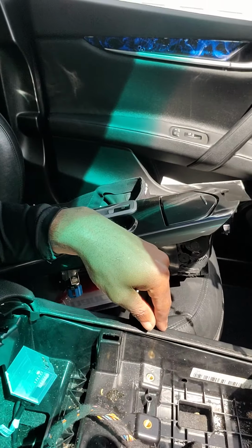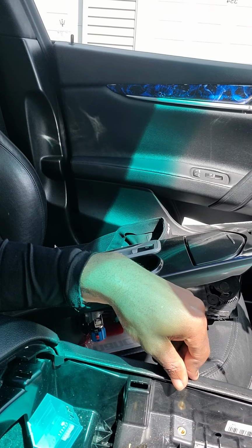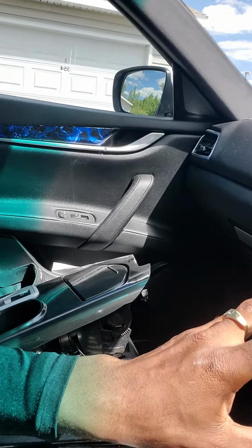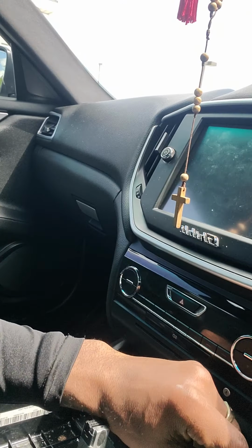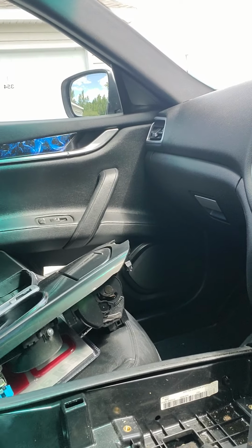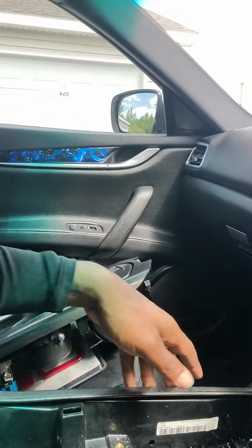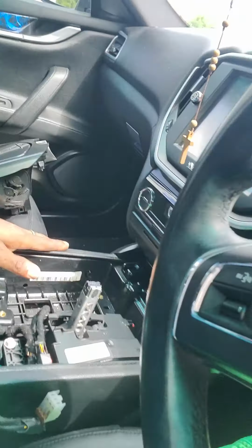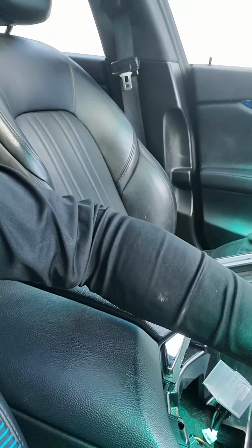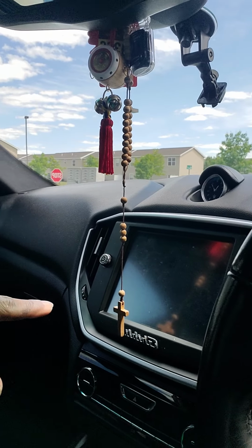All right. I don't know if there's anything else. Oh yeah, sorry. If you want to take off your head unit as well, you have a couple screws down here that you have to do. This whole piece right here pops off. It's the same thing. You use your trim tools, you pop your side off. You have two bolts, one down in here and one down in here, that are holding this whole thing together. Taking off your whole center console is gonna be for another video. This whole one piece literally pops off, and that's the only way you're gonna take off your radio and stuff.